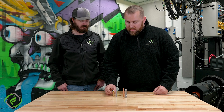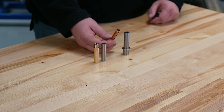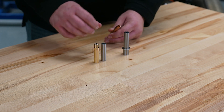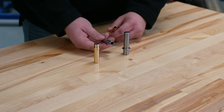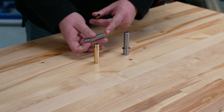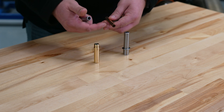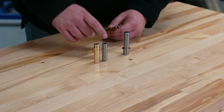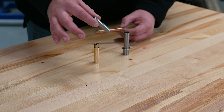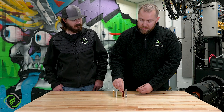Now there's another one right here, and this one looks a little odd. This isn't actually a valve guide — this is what we call a K-liner. It's a bronze sleeve. Initially, what it was for was when these factory guides get worn out, instead of punching the guide out and putting a new one in, we would ream the inside of the existing guide out a little larger, press this in, and then hone, trim, and hone it to size. But when we started doing that, we actually started seeing some benefits of running a powder metal or a steel valve guide with a bronze liner.